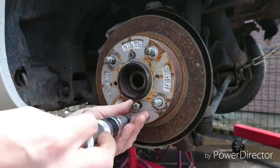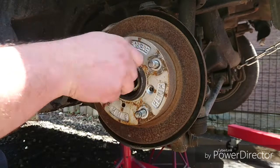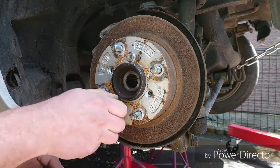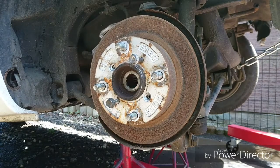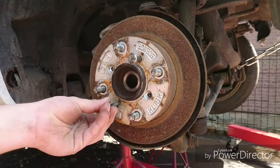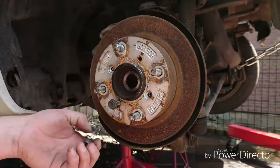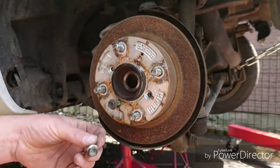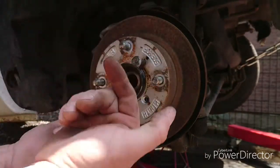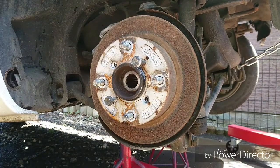Didn't even need it — but that's how it helps them let go. It's always time for lubricant. Nearly out of this WD-40 stuff, so I might start using cutting oil. Quite a lot of rust in there. What I'm going to do is thread these bolts in — they're going to push against the hub and push it back. Need a 12.